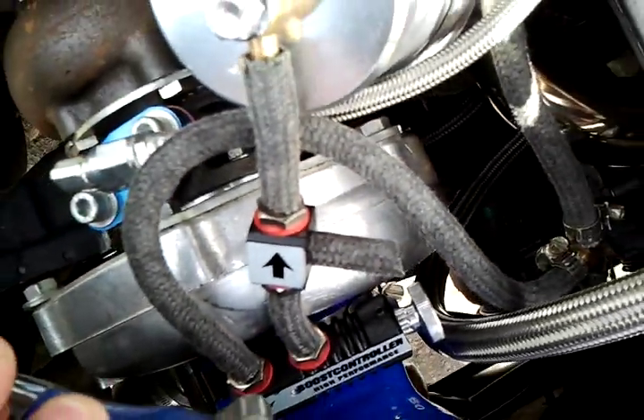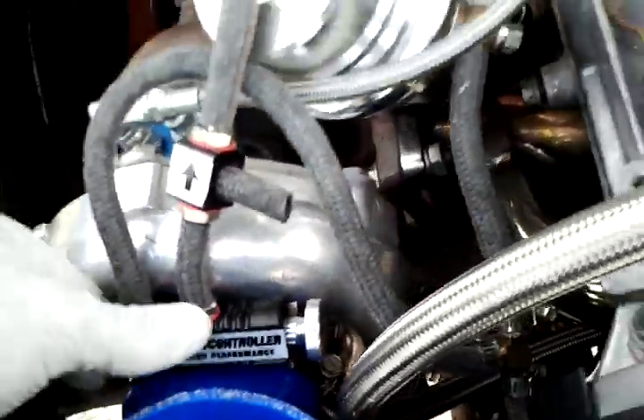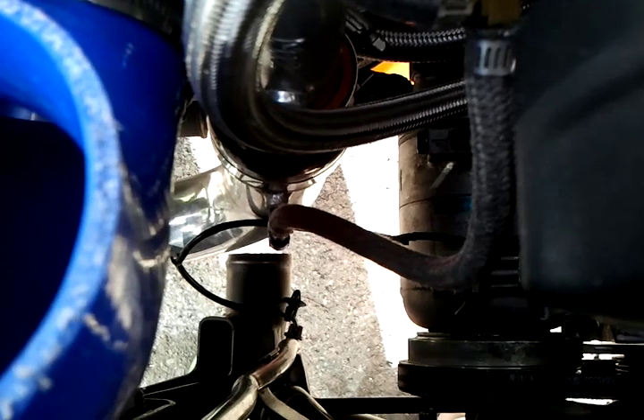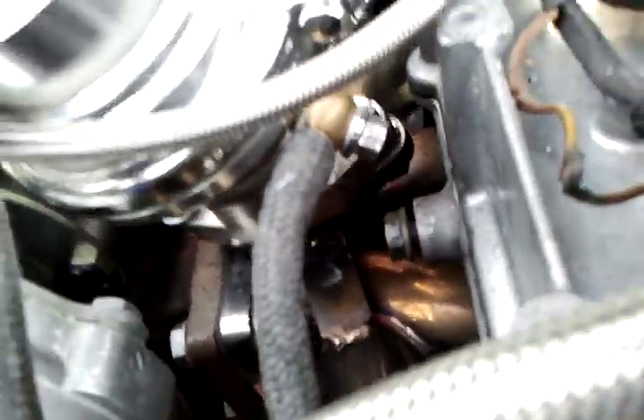The turbo — I have a little boost controller on here. It's pretty easy to put on. The boost gauge is pretty easy too. All I did was, down there there's a piece that comes off my intercooler piping for the pressure side, right after the exducer. It goes up this little hose onto a T.